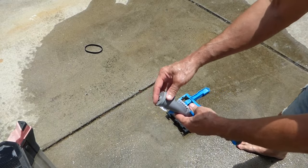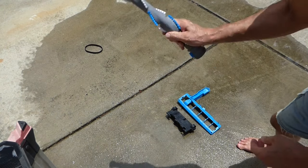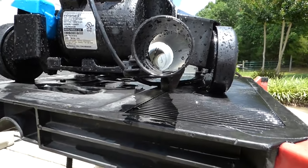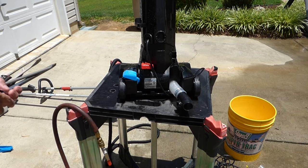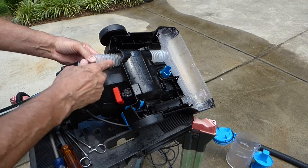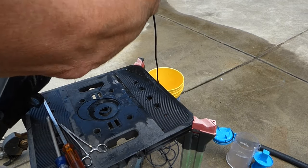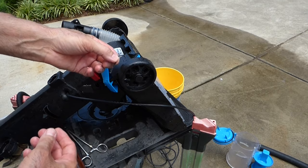On this brush there's a bearing inside of there, so you don't want to shoot water in there. I'm going to let it dry good and blow it out with my air compressor. And I look down in that clogged tube one more time before we put it back together, and I think there's our culprit — there's a bobby pin jammed in there. I want to carefully pull that out because I don't want to puncture this. There we go — that's out. And that's a good example of not to vacuum these hair clips.